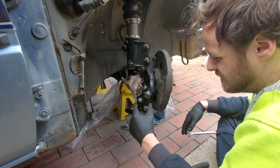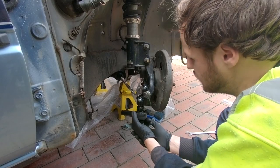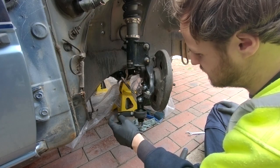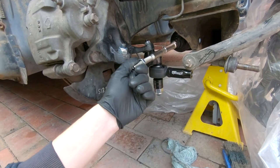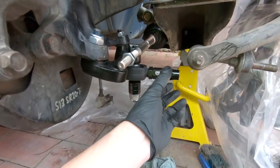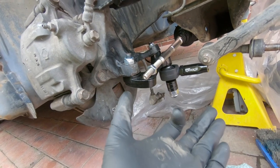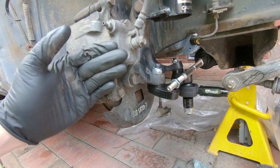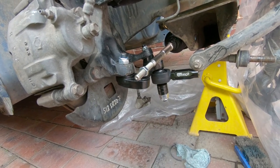I don't know if that's the right position. This already takes into account 40mm bump steer correction. Ideally, as it says in the video, it's meant to be parallel with the LCA ball joint. But as we've seen, I don't have that in. So we're back to the same problem as before — I can't get it to line up properly because the ball joints are so fresh they don't move. So I'm going to wait until next time to actually attach these, because it makes more sense to do that after I've mounted the LCA. Then I can figure out the correct distance and whether I need short or longer ends.